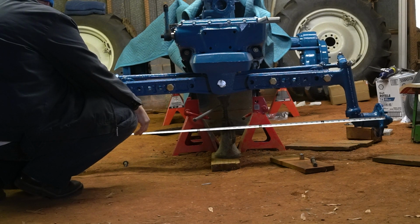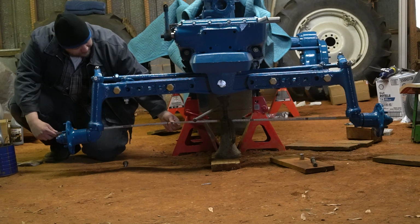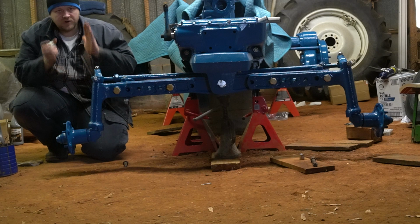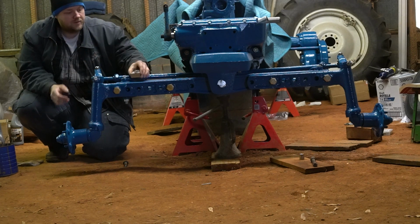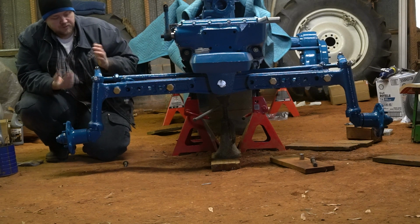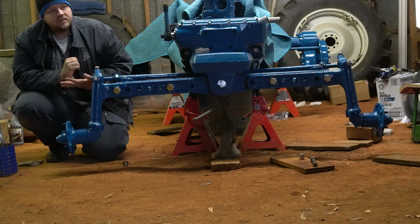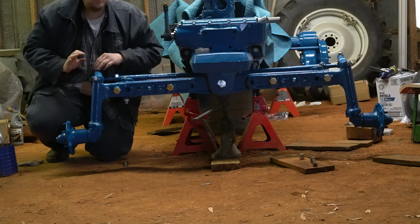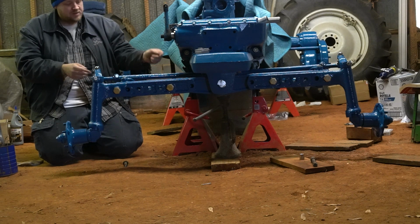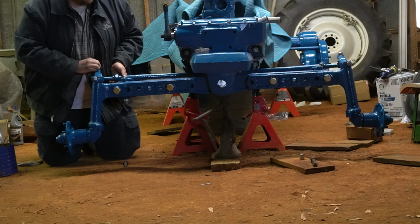61 and 3/4. And I got 61 and 3/4. So at the moment, my tires are going perfectly straight ahead. So I'm at 0 toe. So since I want 1/4 to 1/2 inch with the tire and an 1/8 roughly to 1/4 inch without the tire, I'm going to pull each link, spin it one time, and see where it gets me.